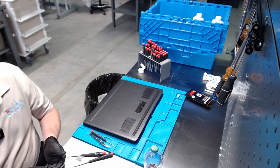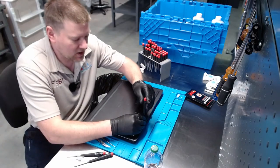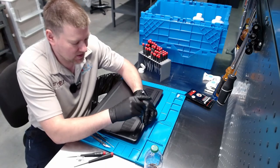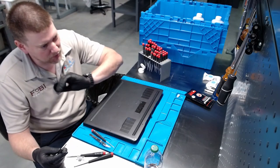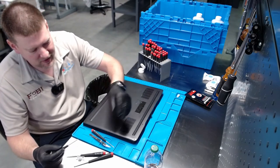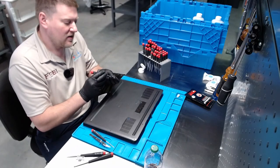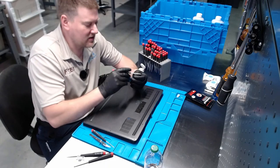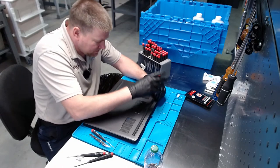And just the same, it's more so about protecting the blades because that's a lot of air pressure. You can sling those fans way faster than what they're designed mechanically. So with centrifugal force, you could blow blades off. I've seen it happen before when people are just reckless and they blow fans, especially with like 100 PSI on a tiny little air blaster. That'll destroy fans. So yeah, just be careful about that.